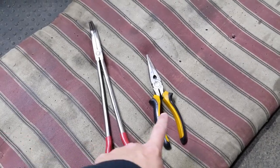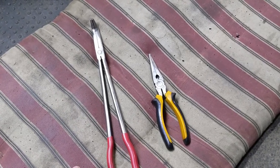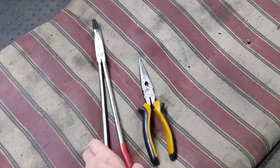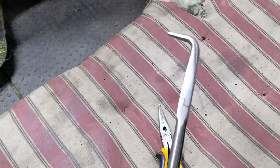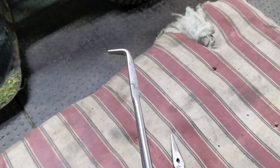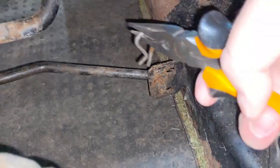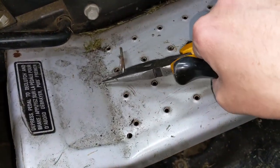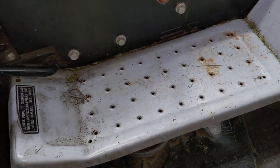Before we lay down I would highly recommend getting yourself a couple pairs of needle nose pliers if you have different kinds. Normally the straight ones will do but sometimes the clips we're going to be removing can be a little difficult. I like using these 90 degree needle nose pliers because I can grab a hold of the spring clip and then pull straight back — they work great. We're going to start removing these spring clips one by one. I like to lay them up on top in order, starting from the front and working our way back.